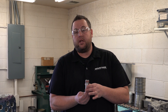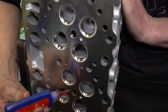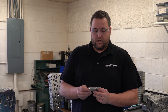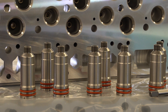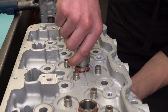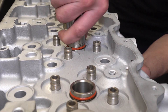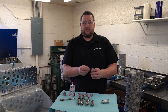One of the things that we wanted to do was design a cup that could stay inside the cylinder head and let the expansion and contraction happen, but still being torqued down or screwed into what we call the fire deck or the deck of the cylinder head. So what we have done is taken a stainless steel piece and threaded it, making it the same dimensions as the factory cup, and then being able to index it so that it screws into the factory cylinder head that has been threaded with tooling that we offer. It will allow it to lock into the deck and let the aluminum cylinder head expand and contract as needed, sliding up and down on the O-rings specified for it.